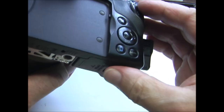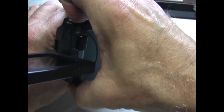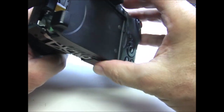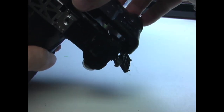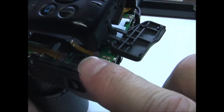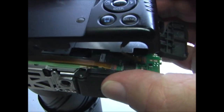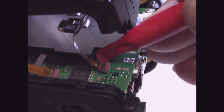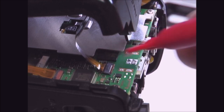Next I'm going to open the LCD screen and rotate it so it's horizontal, and then I'm going to remove the back cover. But you don't want to remove it completely because there's a ribbon cable on this end. So starting on the left side, carefully pry it open, keeping the right side intact, and just slide it slightly to the left. You can see this ribbon cable right in here that we have to disconnect. To remove this ribbon cable, the first thing you have to do is flip up this little latch, and then you can pull the ribbon cable out.